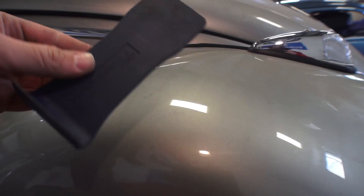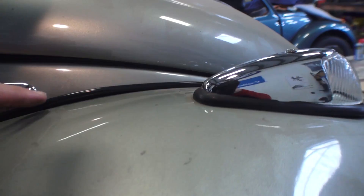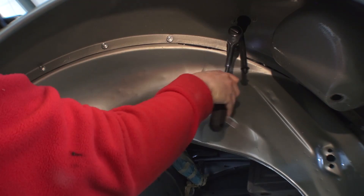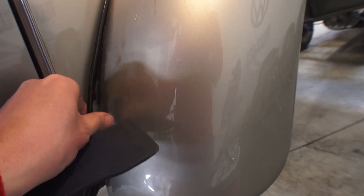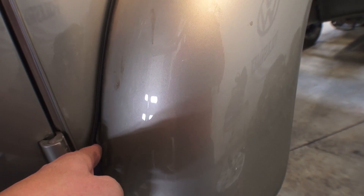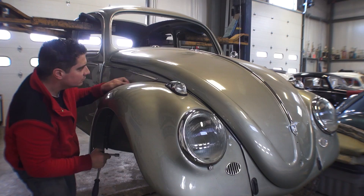In some areas as you're putting the fender bead in it might dip down a little too far. Get a high-impact putty blade, plastic blade, or butter knife — something that won't scratch the paint — and push the bead upward in between the fender and the body. If you push it up a little too much, just push it back down. Once the line is nice and straight you can start tightening down the rest of the bolts. Towards the bottom it can get a little tight as you're tightening the fender down, so use that plastic blade to pry the fender away slightly, or loosen the bolt just a little and work that bottom part of the bead inward. It might be a little tricky here and there, but for the most part it goes right in.